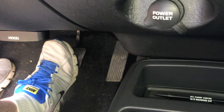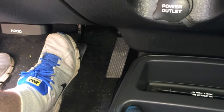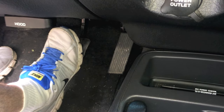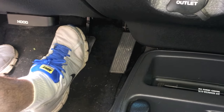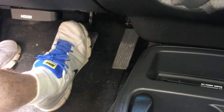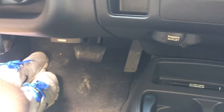So here, the pedal is very stiff. I'm going to start the engine — you're going to see and feel the brake go forward. You see that? That indicates that the brake booster on this vehicle is still good and correctly operating.